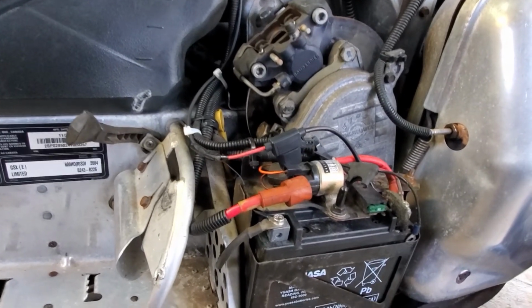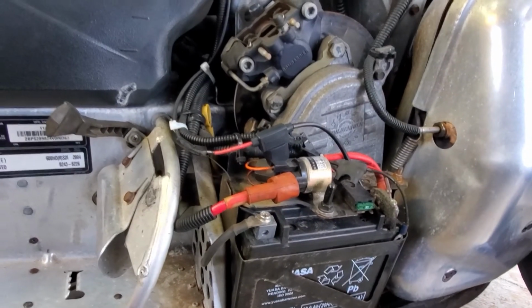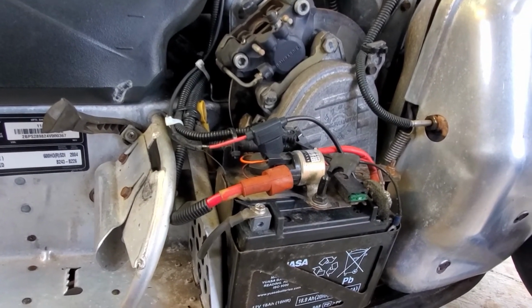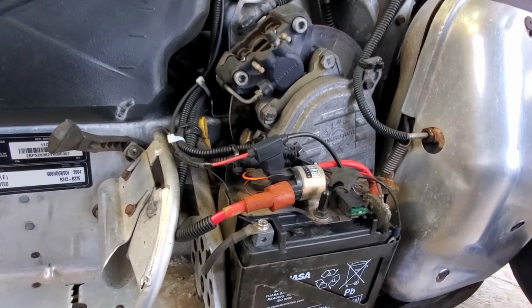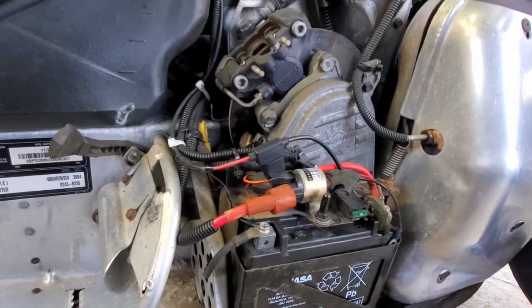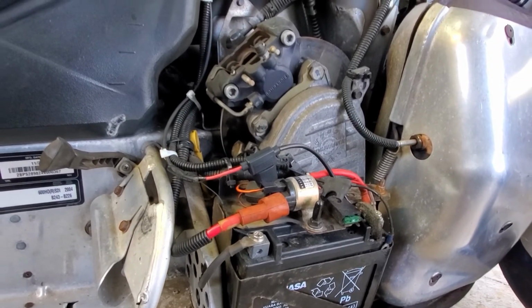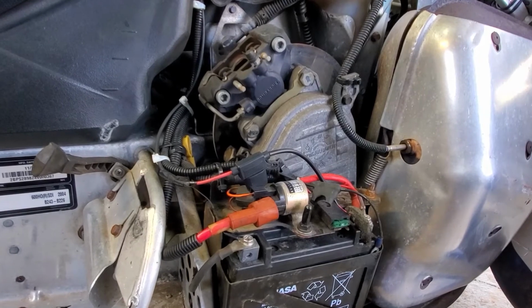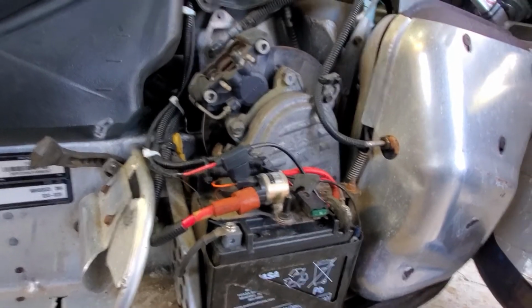You got a couple options here. Here's the chain case oil. I'll put a link in the description and up top here to a video on how to change your chain case oil. You can do it in the spring or you could do it in the fall. That's your call. I prefer to do it before I put it in storage so that if there was any moisture that was in that oil, it's no longer in there while it's sitting. So you can check out that video to see how to do that.